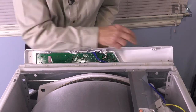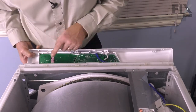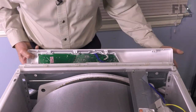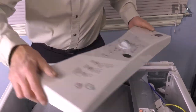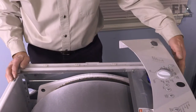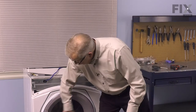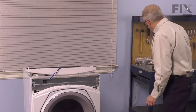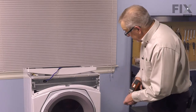There'll be three tabs across the top to engage these little notches. Once we've lifted it out of there, we can then rotate that console up and right on the top of the cabinet. This will expose screws that secure the front panel and door assembly to the dryer cabinet, so we'll next remove those.